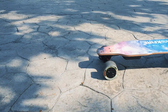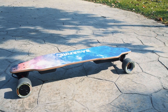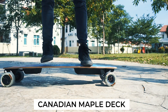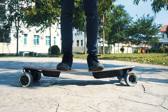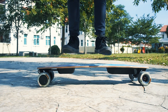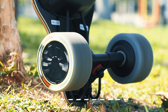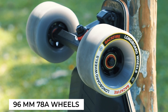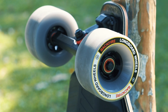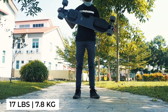To be clear about the comparison, let's first look at the specs of the Backfire G2 Galaxy 2020. It uses an 8-layer Canadian Maple deck, identical to the one on the G2 Black, with only a mild flex and a mild concave — again, similar to the G2 Black. The trucks are the same Backfire proprietary trucks, the motors are the same 400-watt dual-hub motors, and the wheels are the same big 96-millimeter wheels with 78A durometer. Even the weight is the same at 17 pounds or 7.8 kilograms.